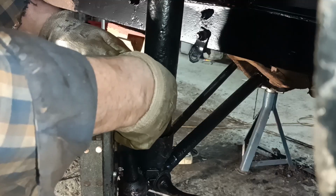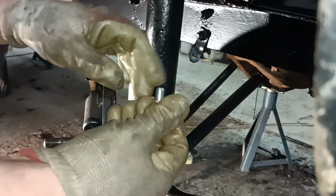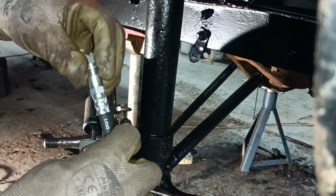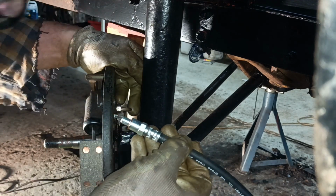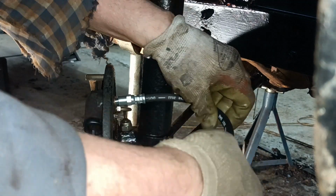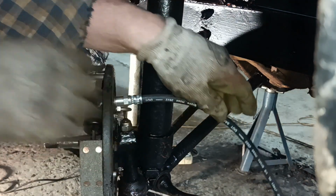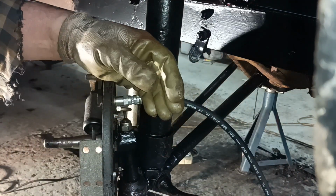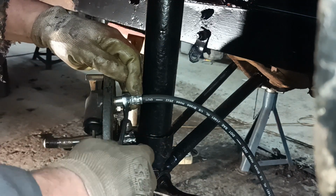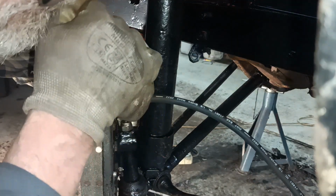Ooh! I put a bolt in there because I had put a copper washer there, ready. There's my hose, there's my copper washer. And I just spent a bit of time looking at the sizes of the hexes. It would appear that this end is 14mm, but that's close to 9/16, so I have got a 9/16 flare wrench here, which is the best thing to use, I suppose.